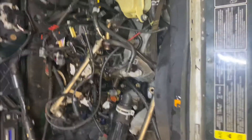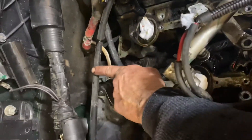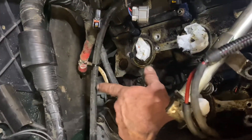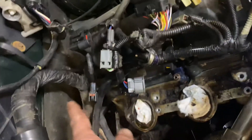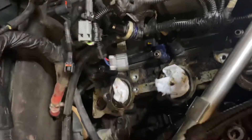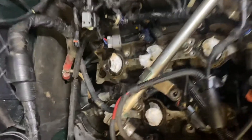Because it can't get vacuum, the valve cover gasket leaks. Whenever you're doing the valve cover or the PCV on this 4.0 liter — this particular one's a 2002 — the location of that hot spot is right about here. There's the head and the valve cover; there's no exhaust pipe, no EGR, nothing there that would cause this that I'm aware of, unless somebody's been in here before. Even if it sat on the head, I don't think it would get that hot.